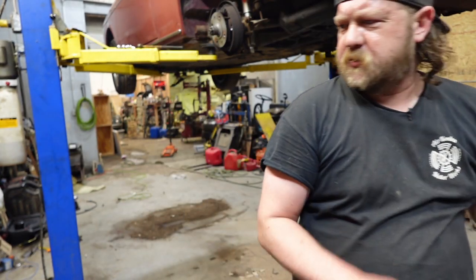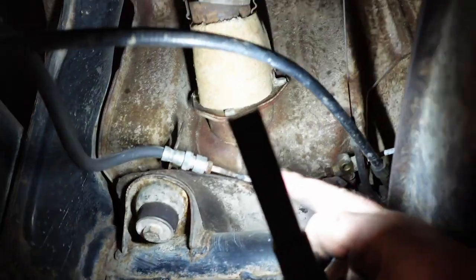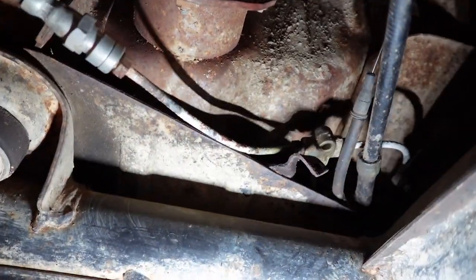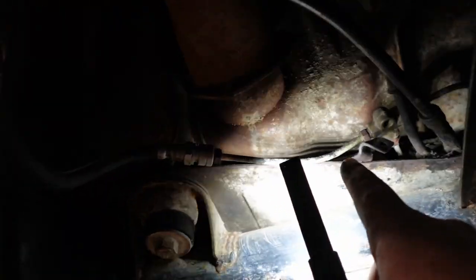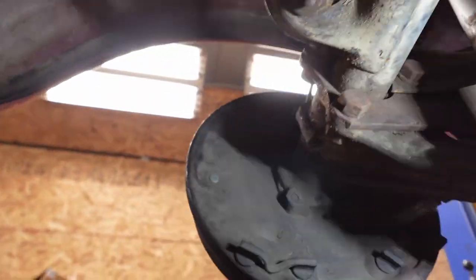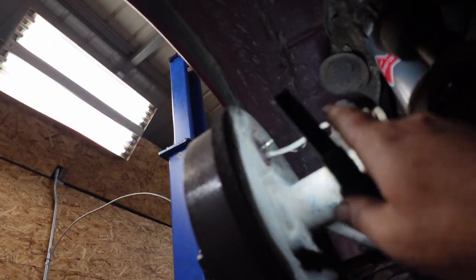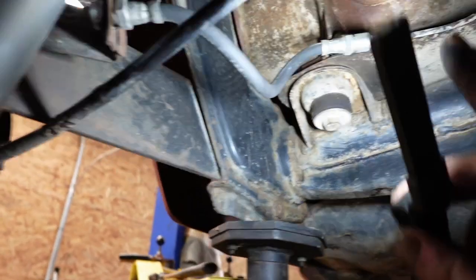I mean, it's pretty simple reason. Man, a simple diagnostic over here. Yeah, that line has seen better days. Hell, the crossover, all these lines have seen better days. But if I'm going to replace this, I'm going to replace this corroded one because I want to get it into the bracket, which is right here. So put that into the bracket, and that line actually looks fine. All right, so we will replace the soft line, this hard line, and then hopefully everything will work fine.